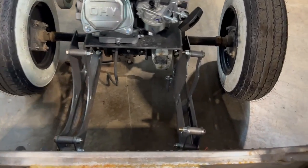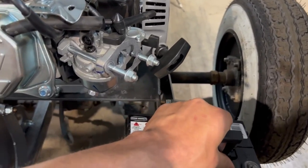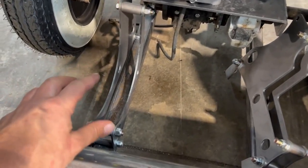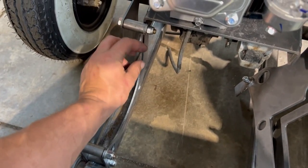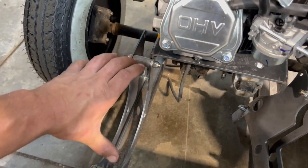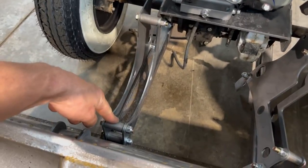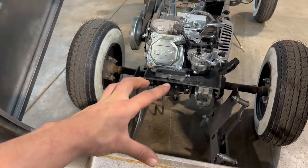Mostly, it's pretty good. I think that you can see what I'm trying to do here. This battery would sit onto the bracket like that. We'd have some strap over the top that holds it. That rounded area here would be for the gas tank. I would put some rubber, just some 1/4 inch rubber tube that has a slot cut in it. I left a little bit of room here so that I could have some rubber that we clamp down onto the gas tank with. So this and this will be part of our top clamp. We'll design that after we get this put in here.